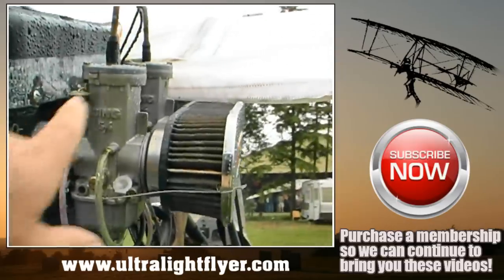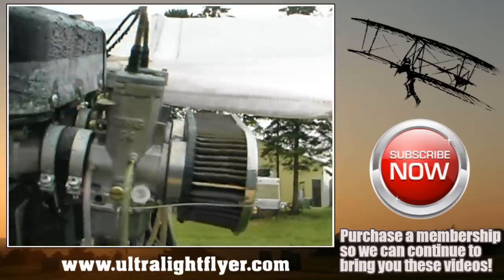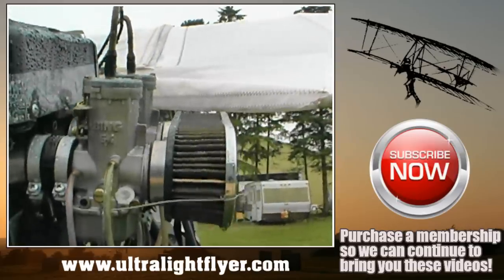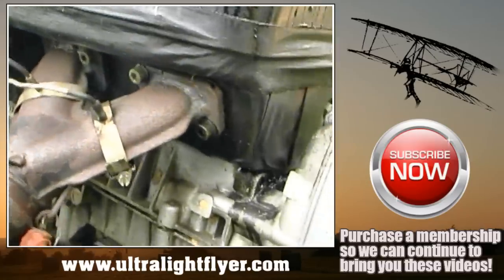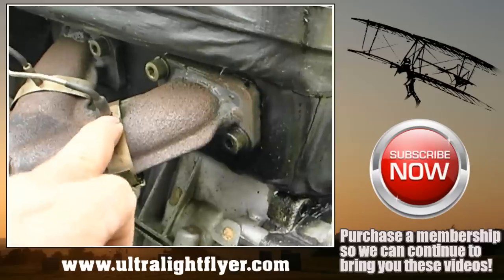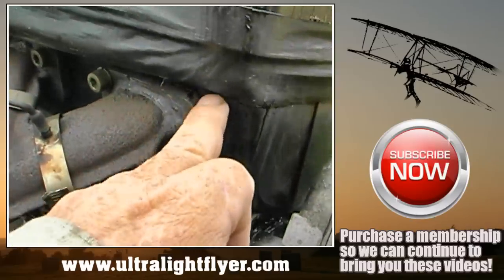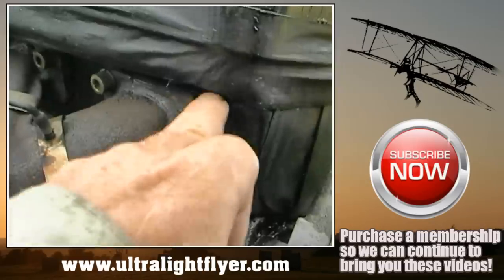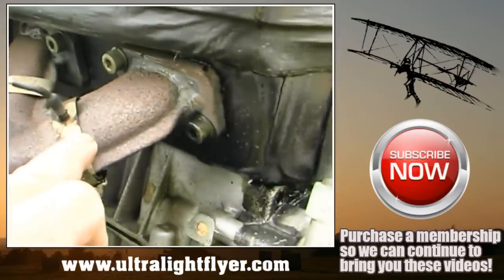This aircraft has a piece of safety wire that is only holding the chrome on — there is nothing actually holding the air filter. On older Rotax engines, one problem is positioning the EGT probe, which is supposed to be located 100mm from the face of the piston. You actually have to come in and measure from the face of the piston to place it correctly at 100mm.